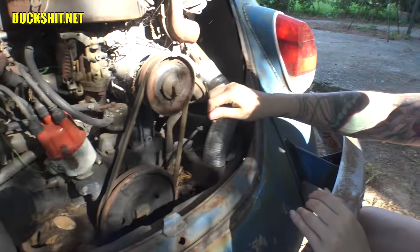While we're tearing apart the inside, I thought we should look at the back window here. Because if this area shows any signs of rust, what happens is the body will let water into it. This back window actually looks like there might be no rust underneath it, which suggests to me that the whole rear package area down behind the back seat also has no rust. As predicted, it's looking pretty good back there. I don't see any rust. It looks like all this original coconut hair and just crap is the original insulation from the back of this Volkswagen. The board that was in here though was a little wet, so there was some moisture getting in from somewhere, but it looks like it has not caused any rust damage to the back side of the car. So these are all good signs.